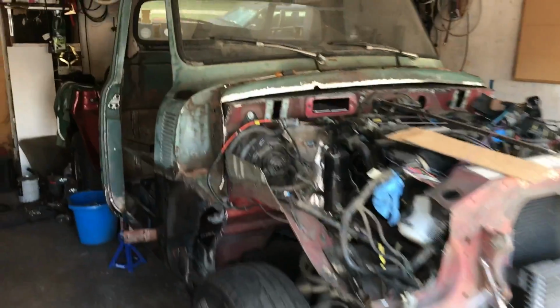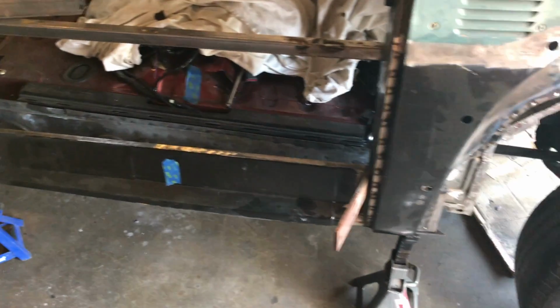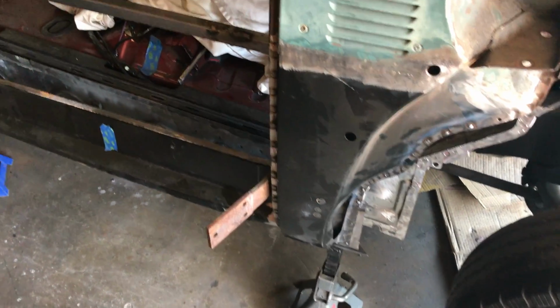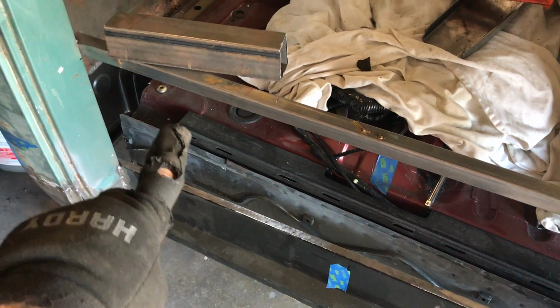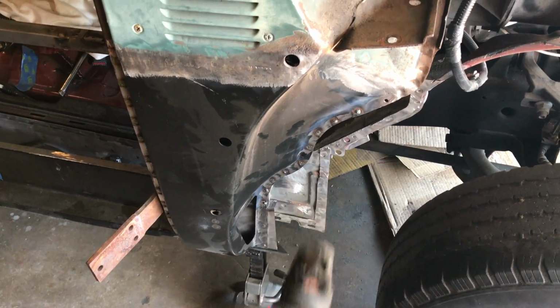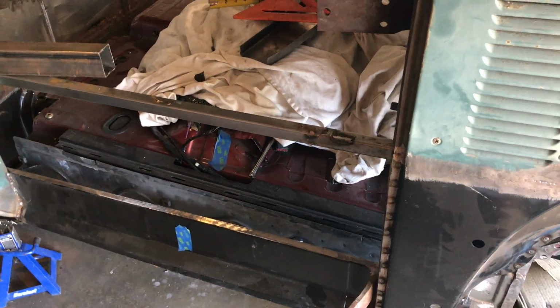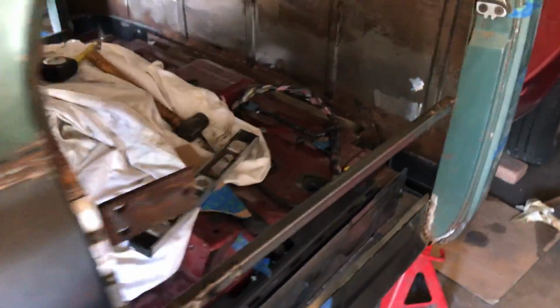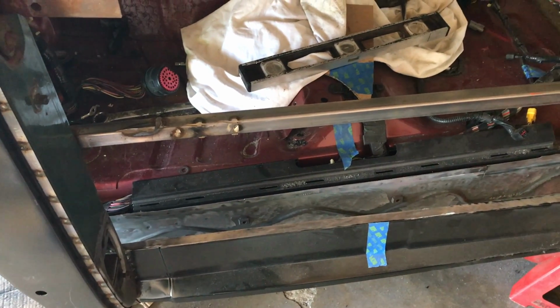It is time for the deep breath. All measurements are within a mil. The cab is shimmed perfectly level with the sill area. Measurements the same. Measurements the same. Front of sill to bottom of A-pillar. This side, everything's level. The truck itself is level. Coming off the sills level. Measurement B-pillar, A-pillar, all the same.